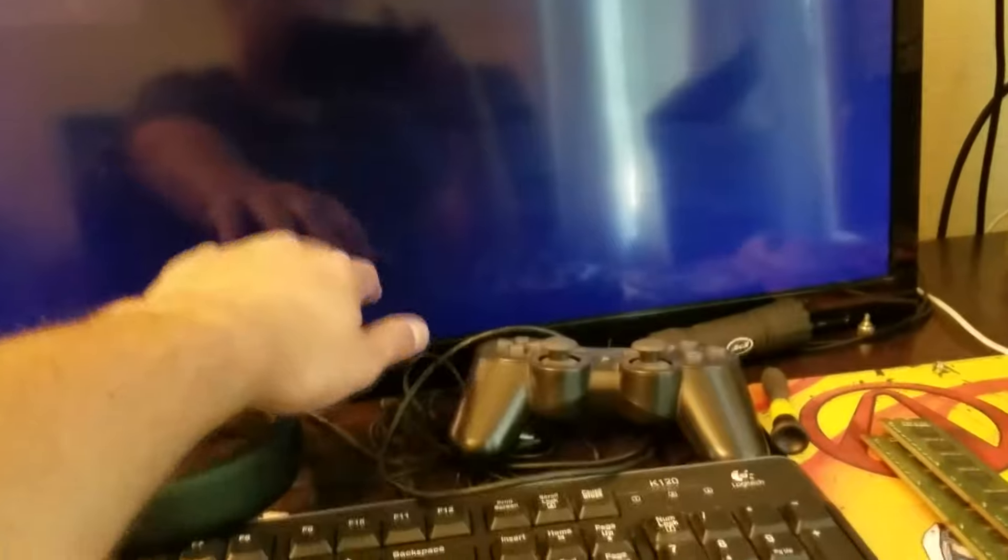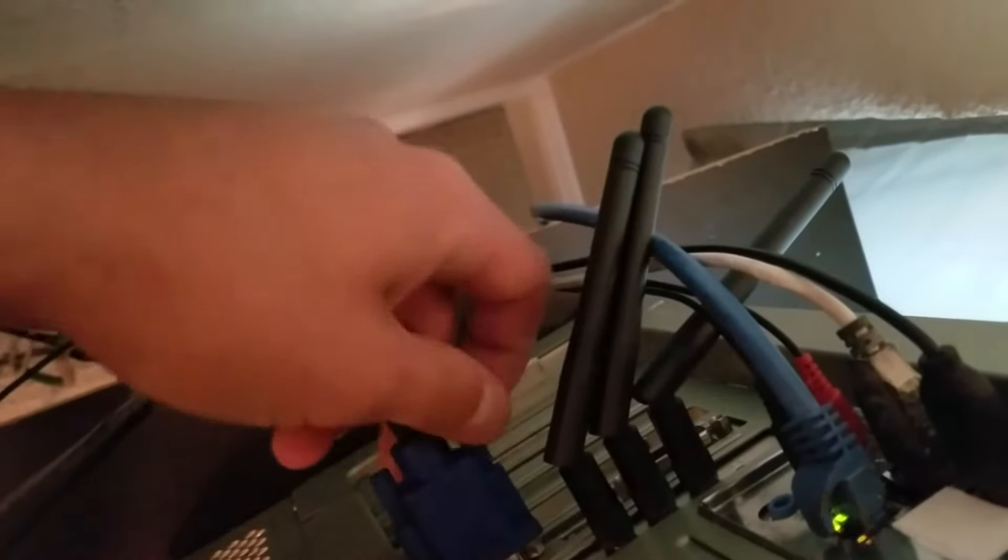The hard drive indicator is going on and off. Is the graphics card plugged in all the way? Looks like it is. And it's spinning. But blank screen — making no sense. Did someone try and clean this screen? It did an awful job — it's got streaks everywhere on it. Like, really? Is it too much to ask for it to work the first time? Well, at least I got one BIOS beep. I guarantee it's going through the motherboard's integrated graphics.